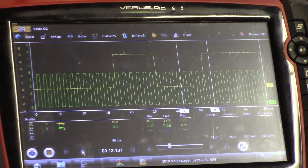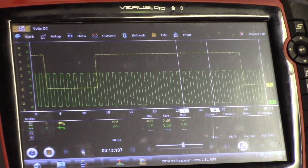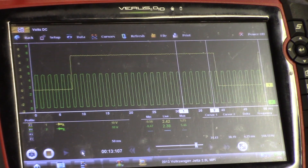There's my signal wire. I'm going to flex on this, try to make my signal come back. There we go — that's me just wiggling this connector. So this is just a failed cam sensor, guys. Pretty simple one, needs a cam sensor.